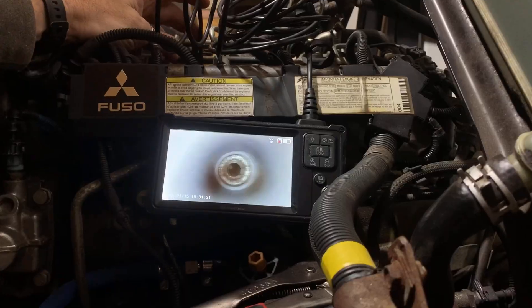Now that I've modified the 17 by 21 taper cutter into a 17 by 19 taper cutter, we can give it a try. But before we just shove this in the hole and start spinning it, there's two things I'm going to do: stick the camera down in there to see what it looks like before, and coat the end of this in grease to capture anything that comes off instead of dropping down into the cylinder — it should stick to the tool.